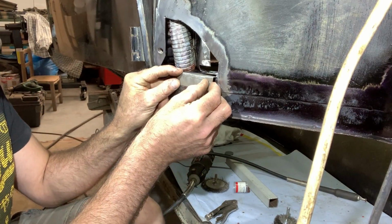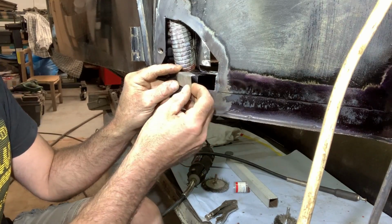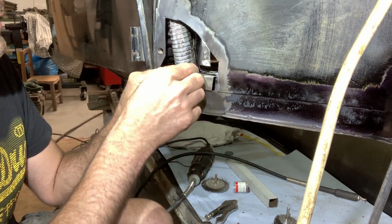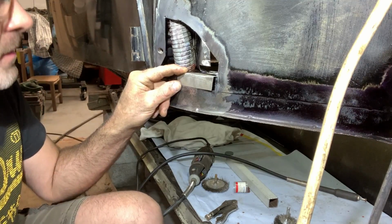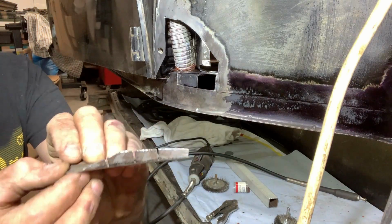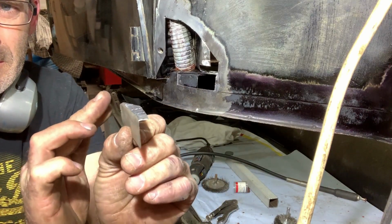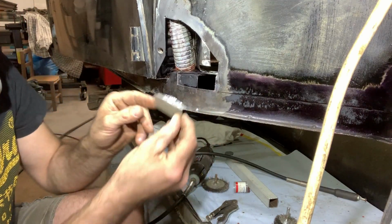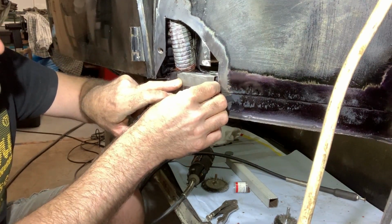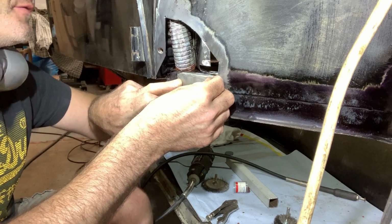But as you can see, here it's doable that I can hammer it in the corner, but from here there's a big corner, so I need to cut this out. Let me mark this. So I made 3 cuts like you see here. Now I can bend this plate with no problems. So I have the 90 degrees and I can bend this plate in place now. Then I have to do some grinding and cutting to make this piece fit very well.